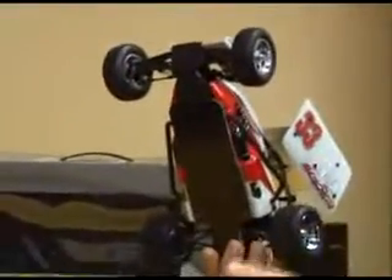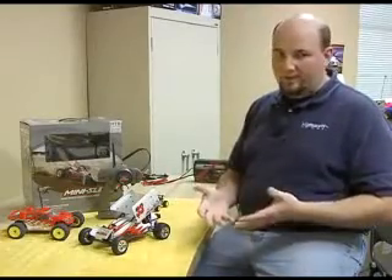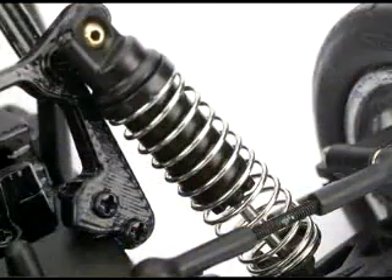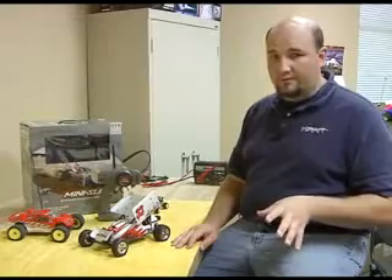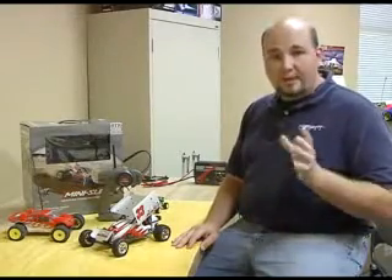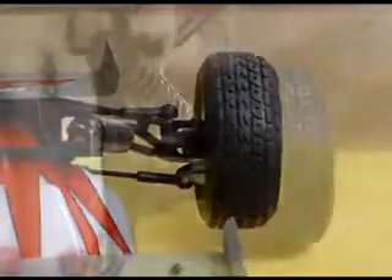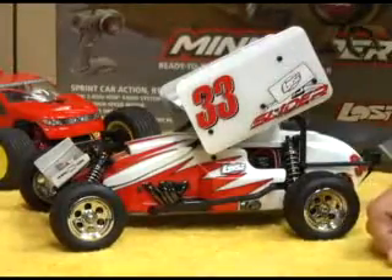There are a number of other neat features the Mini Slider comes equipped with right out of the box. First and foremost, unlike many other vehicles in this size, it does include four oil-filled coil-over shocks, allowing the car to feel very stable on track, in a driveway, or on a variety of different surfaces. In addition, the camber and toe links are adjustable front and rear, so you can adjust toe in and toe out, front camber, or rear camber. You can also adjust the angle of attack on the main wing, along with some other key adjustments as well.